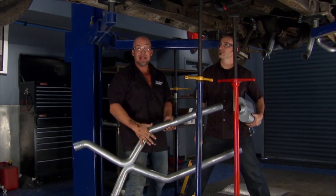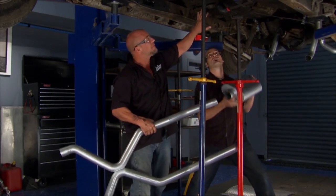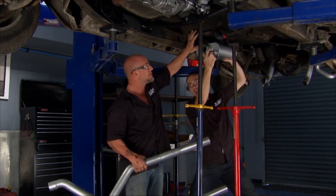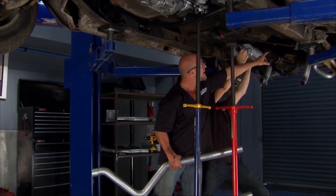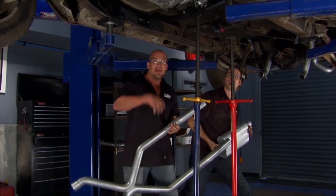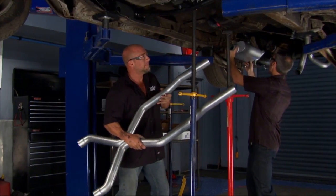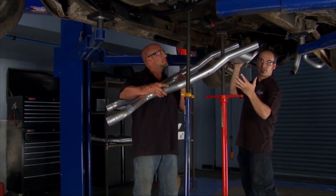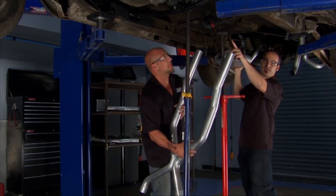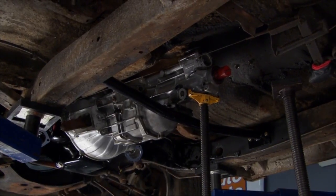From Schaefer Classic Reproductions, we got ourselves an exhaust system, and this thing is great. Right out of the gate, I noticed one thing: a lot of muffler shops use these stock mounting brackets for exhaust, and you get a lot of vibration that travels through the frame into the cab. Well, the guys at Schaefer made a cool little bracket that uses the body mount, so you can get the muffler back towards the back of the car — it eliminates a lot of that vibration. Any time you're putting custom headers on, the mounting flange up at the front is always going to be unique and different. We've also got an aftermarket five-speed trans in the car, the whole assembly moved back about an inch, so we've got a custom cross member that may end up right in the flow of traffic.